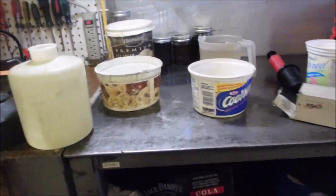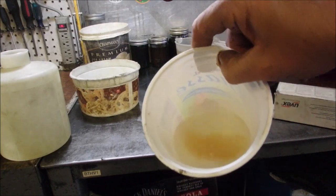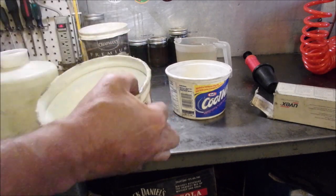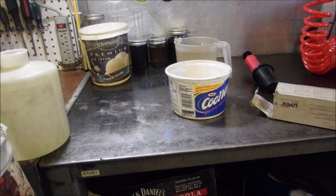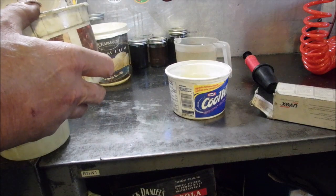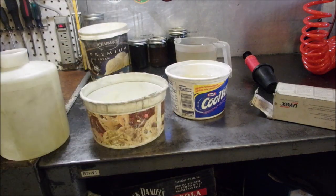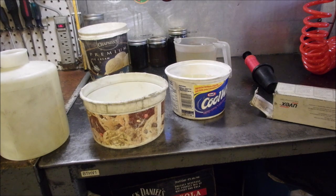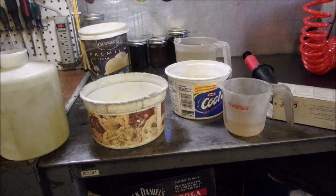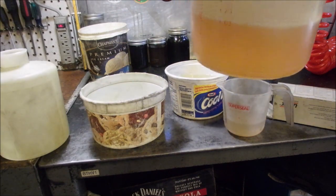One moment, please. I know I'm walking around with a camera. Okay, so this is the gas I took out of the line. And it doesn't look any better. That gas looks fair. But that gas has water in it. And I'm just looking around for anything to store it in that's semi-clear right now. Whoops. There we go. Dropping stuff already. Good Lord. Okay. So even when you think you're doing good, you could be screwing up. But that's definitely an ethanol water mix right there.